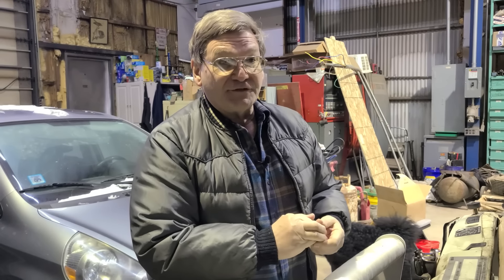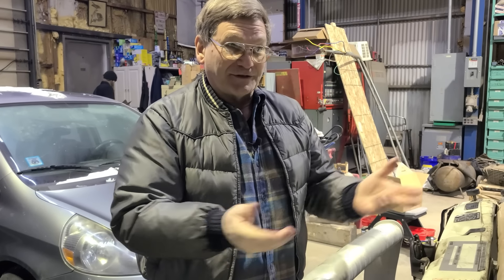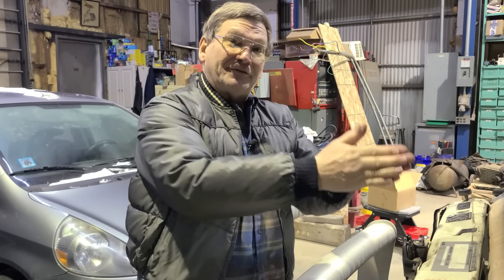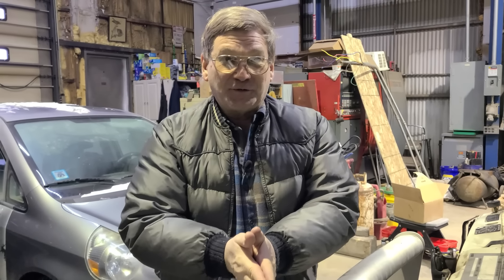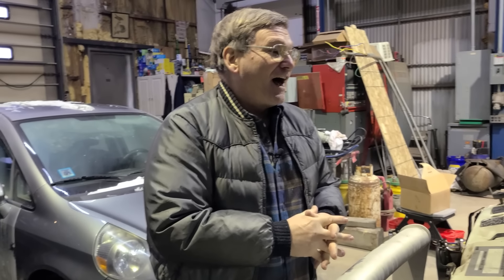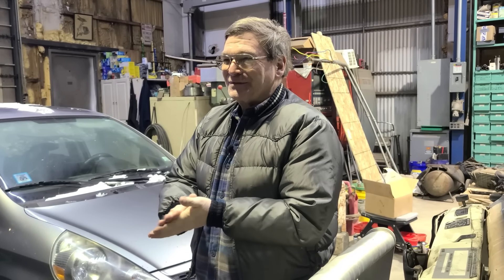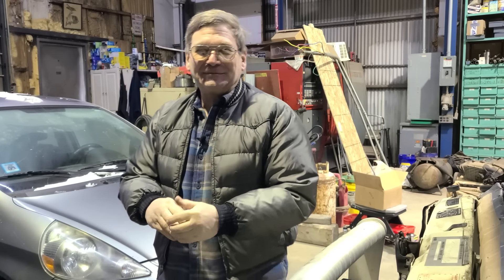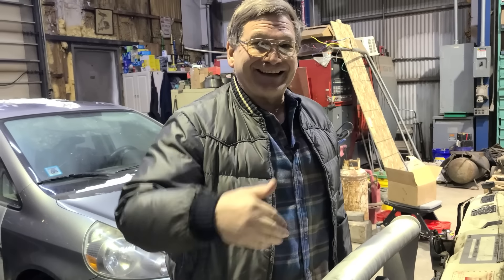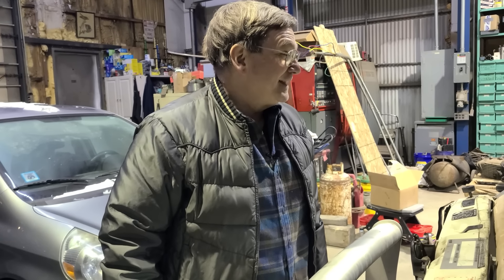If you plug it in all the time when it's warmer out, you should change your oil a little sooner interval through the winter — a heater sized for 40 below is too much when you're plugging in at 20 above. For recommendations on how much heater wattage — like what to put on a Cummins with 10 gallons — I forget the exact number I had in mind. It was more than 50 watts and less than 200. You can write it down in the comments if you know from Canada or Alaska.